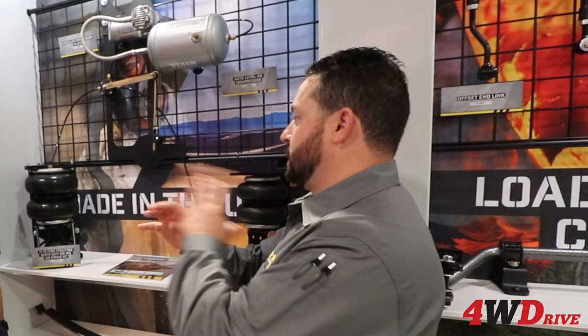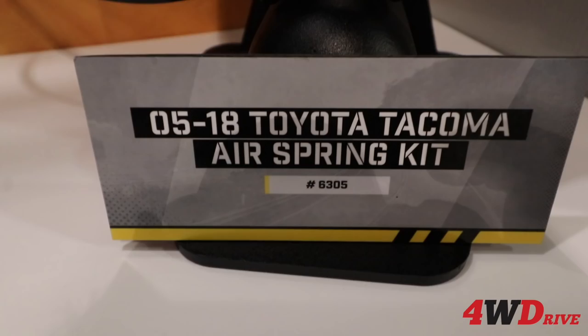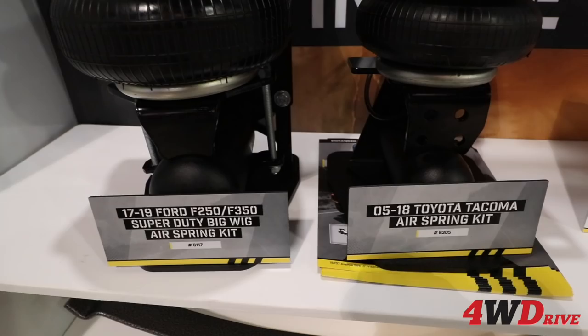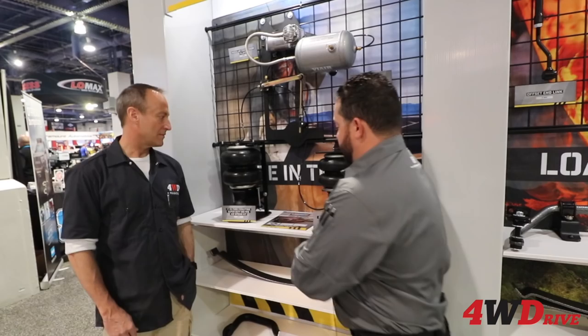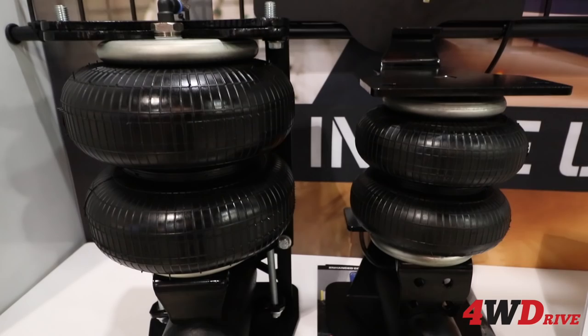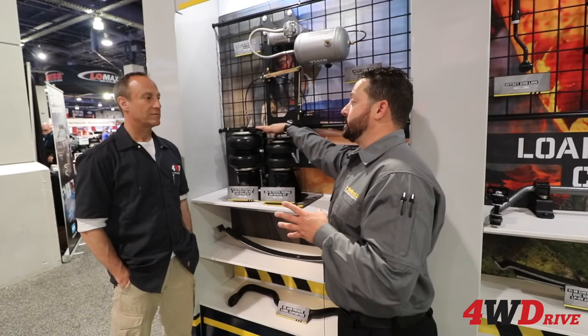These are the two airbags — air springs — that we offer. The 5000 series goes on a Toyota Tacoma or lighter half-ton trucks, keeping you level up to 5,000 pounds. What sets us apart is our Big Wig bag — there's a significant difference in volume. No replacement for displacement applies to airbags too: to level a heavy load with a smaller 2500 series bag you need 70-80 psi, but the Big Wig bag levels it at 40-50 psi. Higher psi makes it spring back like a pogo stick, whereas the larger bellow at lower psi rides like your factory suspension — going back to our three C's: control, comfort, and confidence.